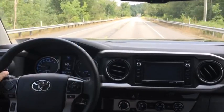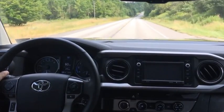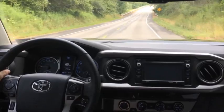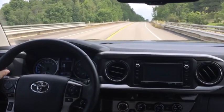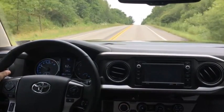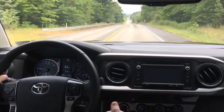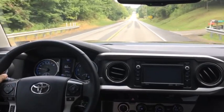Another thing with Shift Sense Pro: we have a hill coming up ahead. It performs all downshifts as necessary for passing and for climbing hills. As we get into the hill, we should see it downshift to fourth gear. We're steady at 60 miles per hour — I increase throttle pressure and it kicks down to fourth as necessary. As we're across the hill I'm lifting on throttle pressure and it shifts back to fifth. I don't expect to see sixth on this drive because the minimum upshift speed to sixth gear is 72 miles per hour — we won't be approaching those speeds on this two-lane highway, so it will maintain fifth gear. The nice thing about that is you don't have to worry about any of the gear hunting between fifth and sixth gear that you normally see in drive.